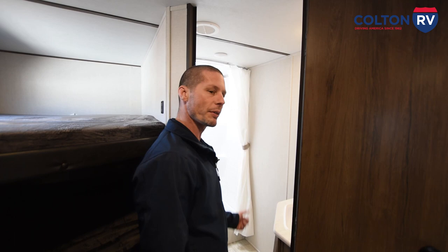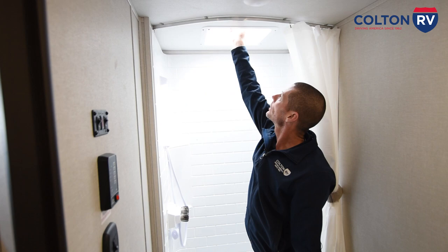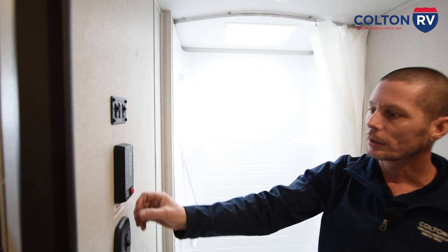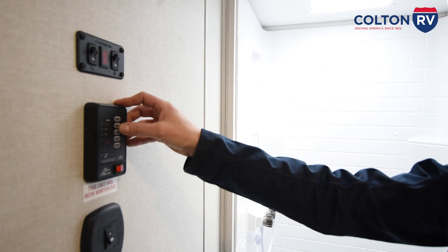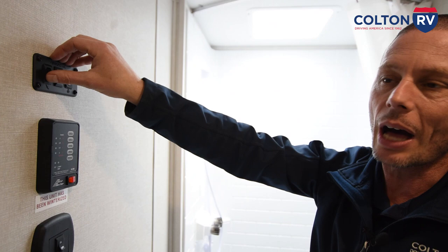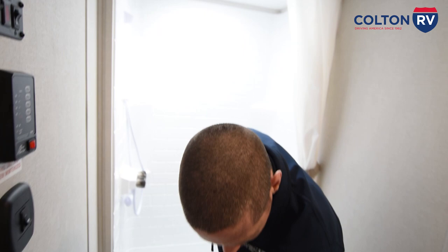In the rear of the trailer you have your bathroom here. On your shower, just your hot and cold. Up here you have a vent with a little switch to turn it on. All your lights on your ceiling have push buttons on them to turn them on and off. Now here you have your battery, your fresh tank, black, gray one, gray two. Gray one is your kitchen, gray two is usually the bathroom. Then you have your water pump switch here to turn on your pump to pump water from your fresh tank throughout your trailer. Right here are your switches to turn on your hot water — the lightning bolt is electric, the flame is propane. Storage under here and storage up here.